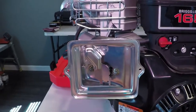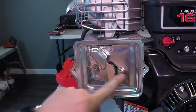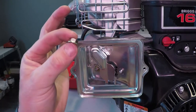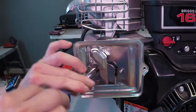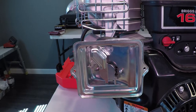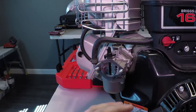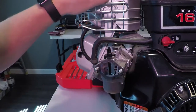Next, let's figure out how to get this base plate off. Very easy — it's held on with these two nuts here, 10 millimeter. What do we do with the components that we take loose? Put them in our magnetic tray for now. Now our carburetor base plate will be able to come off. This exposes the engine just a little bit. We have a fuel line here, our carburetor gasket here, carburetor bowl, and so on.